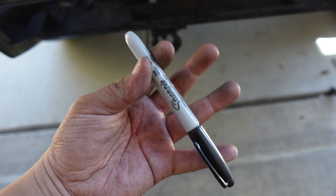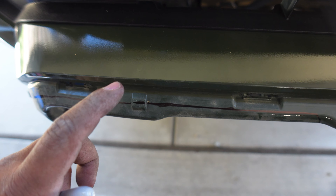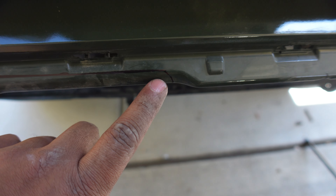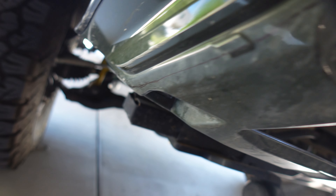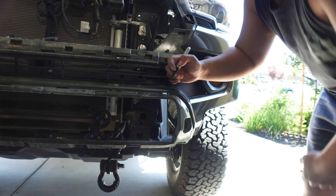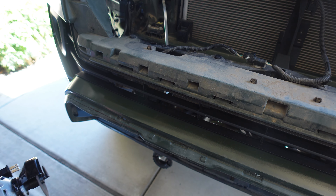After you've taken off the bash bar, go ahead and take a sharpie and mark off where you're going to cut. This little lip right here — you're going to want to keep half to three-quarters of it. You only have to go up until right here; the center part you don't have to cut. The middle part I'm not touching — it starts about right here and follows all the way around. Doesn't have to be perfect; the bumper is supposed to cover the little flap you leave left over. Before you start cutting, always wear eye protection — there could be hot plastic flying everywhere.